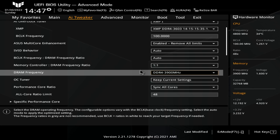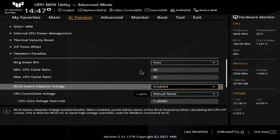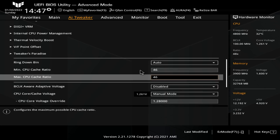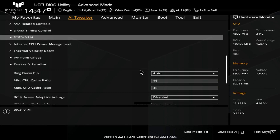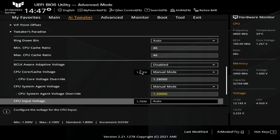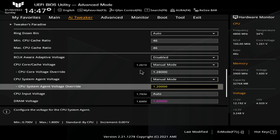We're at 3900 megabits per second. Let's go over the voltages first. Ring is at 4.6 GHz, core voltage at 1.28V mostly because we're on the air cooler. If I wasn't on the air cooler, I'd be pushing the CPU to around 5.1 with 4.8 ring, but air cooler, so 1.28V. System agent is all the way down at 1.2 volts.